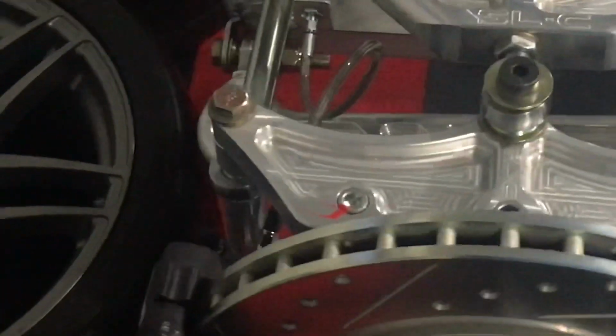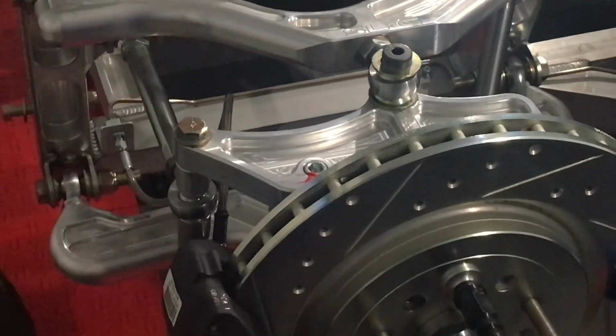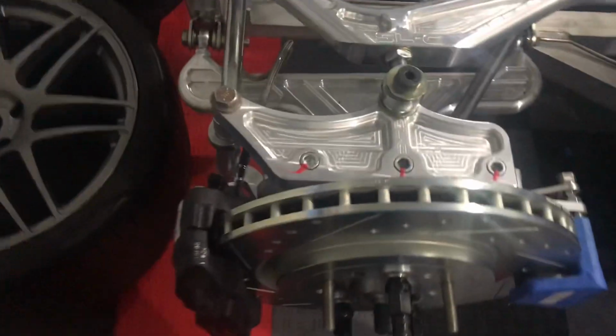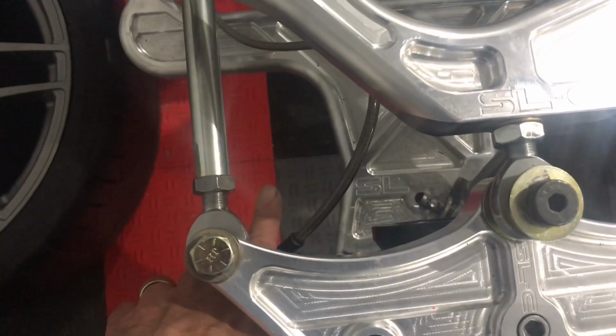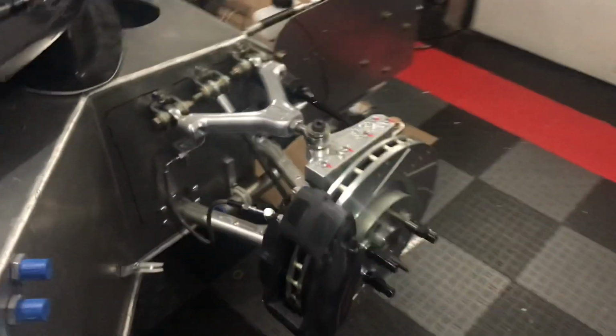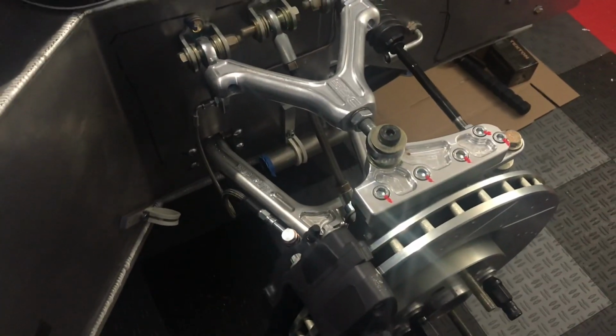And that comes to the inside here, and then it drops down. But it also just seems like a lot of line, and you probably have to attach it, maybe attach it to here. But for New Jersey inspection, I think they like those brake lines free floating and not attached to anything that's moving. So I ordered a 90-degree banjo fitting to really come around this way and just use a shorter line and connect it right there. So in the next segue, when I get those parts, we're going to plug them in and we'll see if it lays a little better, then we'll figure it out.